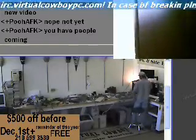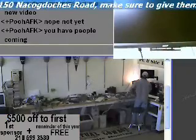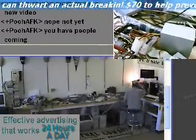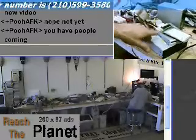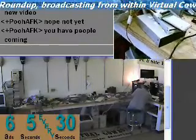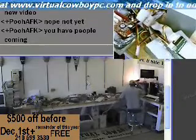Then the computer reboots. We let it go ahead and boot up. While that's booting up, we're going to turn to the desktop bench tester. We have our power supply hooked up, CPU fans hooked up, one stick of memory. We have a CD-ROM hooked up on IDE with a little adapter — that adapter is $3.50 by the way — that hooks up to a laptop drive. It needs power. We have our floppy hooked up on its own ribbon. This is a single IDE board.